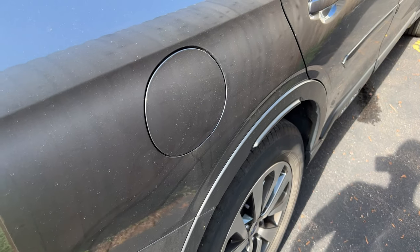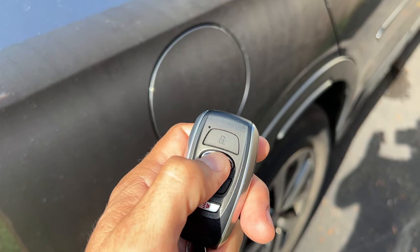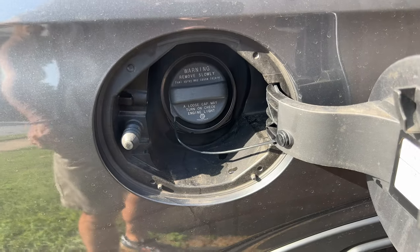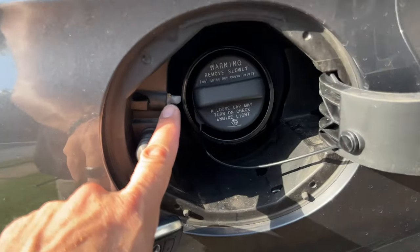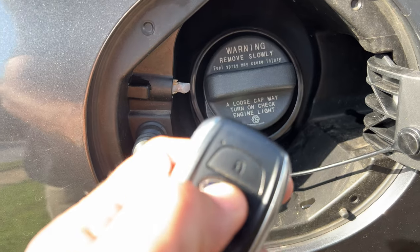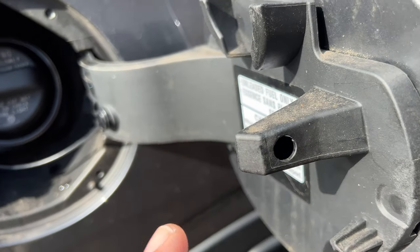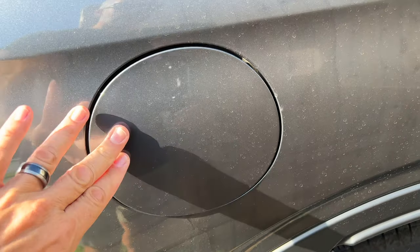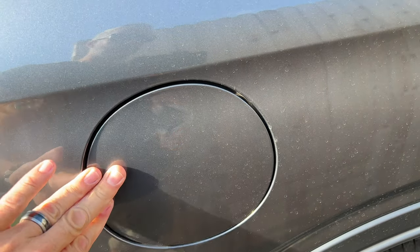Car's turned off, doors are locked. I'm not going to jump on my head and do anything silly, but let's try something — what if I hit unlock? If you're standing near the gas tank, you could hear something moving. Holy smokes. We're going to look for a little locking mechanism here when I hit lock, because I'm starting to think that maybe this is what does it — right there. So check it out: I hit unlock, it takes it away; I hit lock, it comes out. Look at your gas cap door right here. When you lock your vehicle, this lever comes out — this little locking mechanism, this bar unlocks it. Car's unlocked — open. Let's hit lock. You can hear it moving in here. Secure.